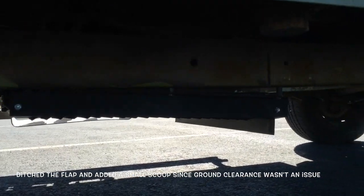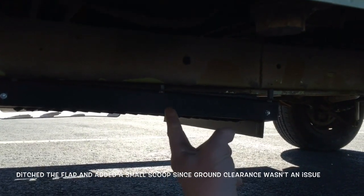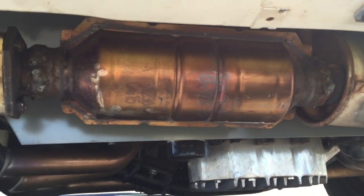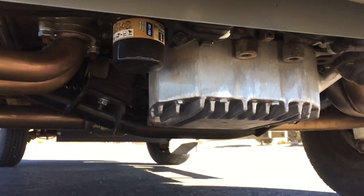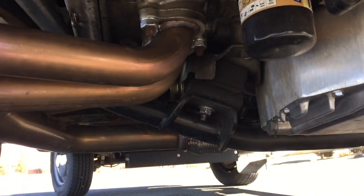You can see it's kind of canted slightly. There are some spacers right there and there. Since this is a California bus, we had to use the catalytic converter, so I just used the original exhaust. We have the KEP exhaust manifold, small car oil pan, and Bussaroo crossmember.